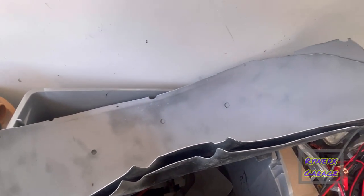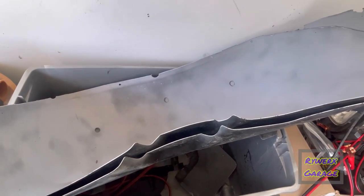I just laid some primer on there to make sure the paint was going to stick, because I painted these once and I didn't use the flex paint, and they flaked on me real bad. I rushed it, honestly, I was just anxious to get them in there. I painted them and ended up wasting more of my time because I had to pressure wash them, strip them down, re-sand them, and actually take the time I needed to prep them.